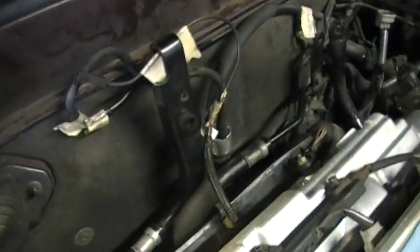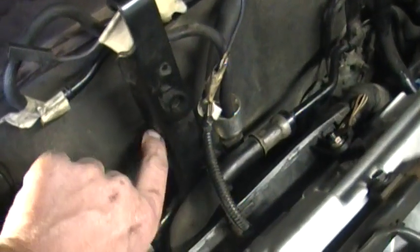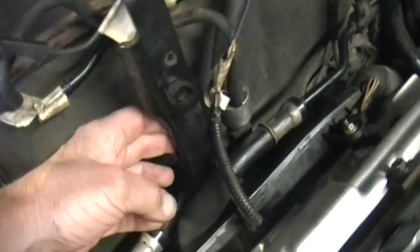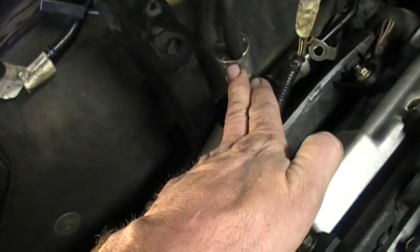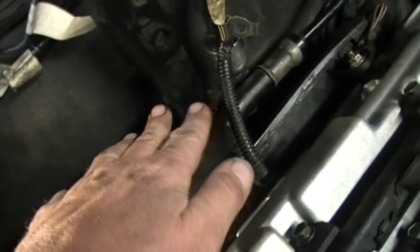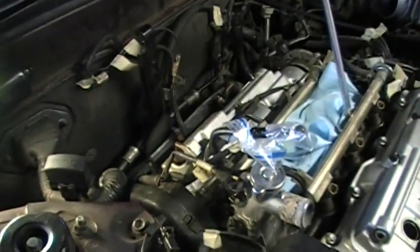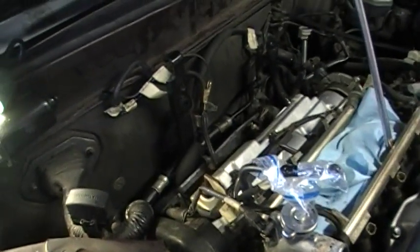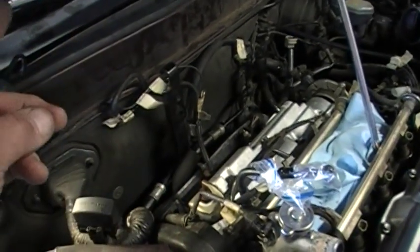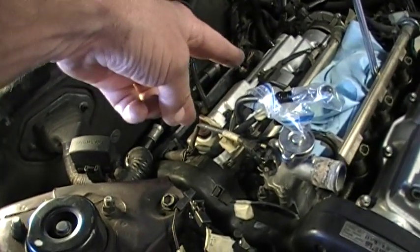Once you unbolt this it will move around. The other key is there's a bracket right here on the top — there's a stud that faces backwards. You use a little 10 millimeter wrench, unscrew it, and it disconnects this piece from the bracket. Then down below on the lower side of the engine there's a bolt that requires a 14 millimeter socket — I had to use a very long extension from underneath to get it off. Once you get that bracket off, get this wiring harness case loose and up.